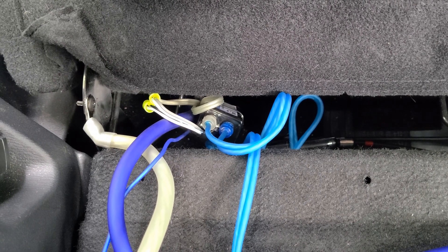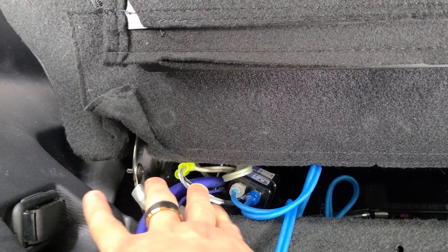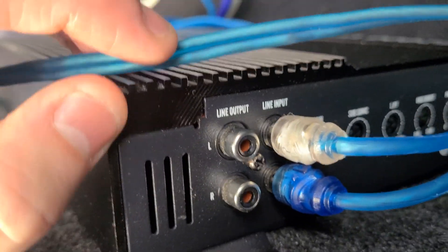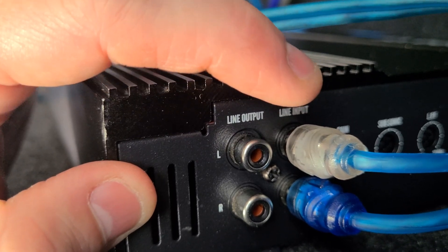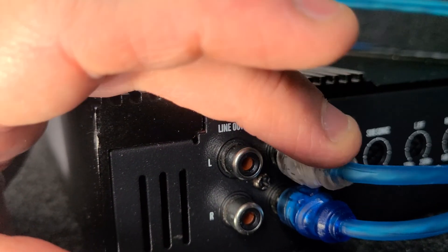Try to pull from wires and speakers that will make your subwoofers sound as good as possible. We've pulled the positive and negative wires from two of the rear speakers, hooked them into the converter, and on the output side you plug in your RCA cables. Following that cord, it connects to the line input on the amp — you can set it up for left and right channels depending on your amp configuration and whether you have one or two sets of RCA cables.